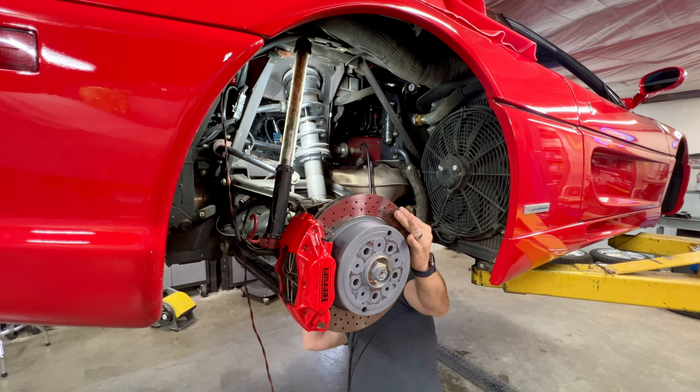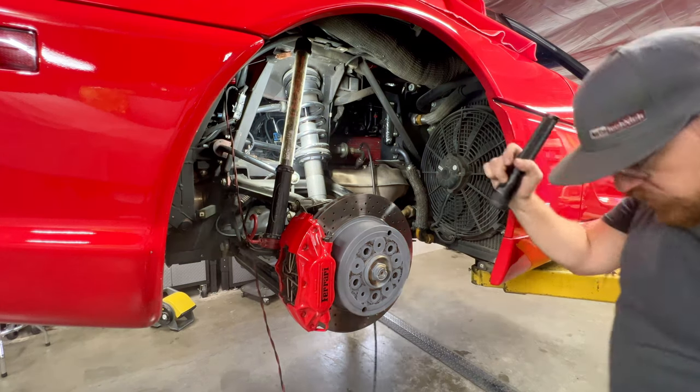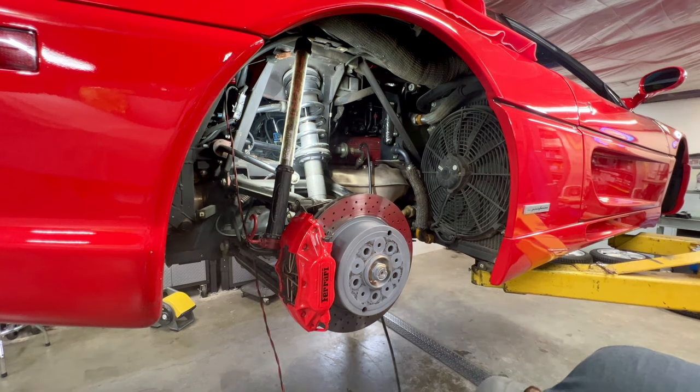And another thing I have seen that's kind of common is the exhaust studs on the head break, and the flanges will warp and they'll leak from there. You can have the manifold milled flat again and replace the stud, and usually you're back in business, so it's a much better option, or I guess a better failure than a cracked manifold. So we're going to call this one good. I see no visible leaks.